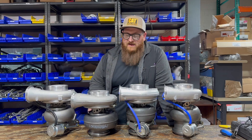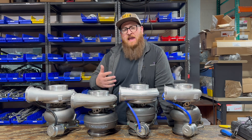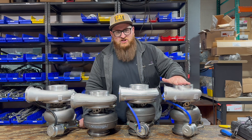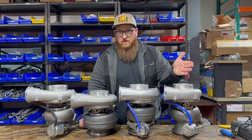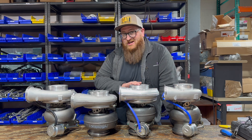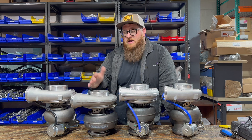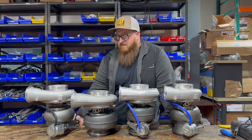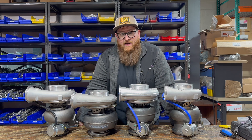Let's do a quick recap — this video isn't to say any of these turbos are bad; each one has positives where it shines. The stock GT4294 is a great turbo for a stock truck with a smaller 71 by 94 compression wheel. The K31 is a great upgrade that spools up great but won't have a ton of top-end power. The S400 has a ton of top-end power but won't spool up great on a stock or lightly modified 12.7 liter. And our ultra turbo spools up great, makes good top-end power — really the best bang for your buck as an upgrade for a stock or lightly modified 12.7.